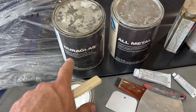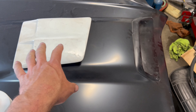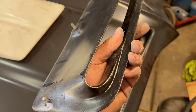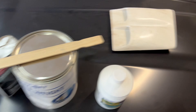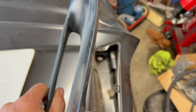Now we still have DuraGlass, which is a fiberglass reinforced filler. This stuff is clumpy, lumpy, and chunky, but it serves its purposes — it is water-resistant. So if you've got an area you want to sculpt or make hold up, that's probably the product. I like using DuraGlass on these side scoops, which are actually fiberglass side scoops on these cars — I like to basically keep the same material. Same goes for these hood inserts; they are the fiberglass ones. They make a rubbery foam version, but I can't do body work on those as well — they just flex too much. If I've got to take care of areas like air pockets, I would use that fiberglass filler to fill that in. Fiberglass parts normally need a little bit of sculpting.